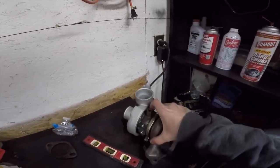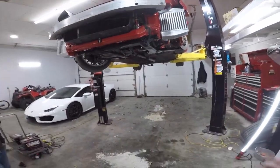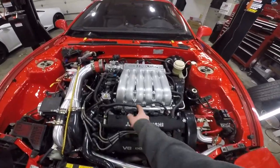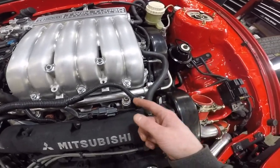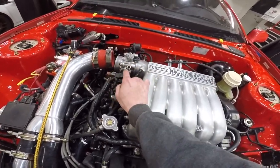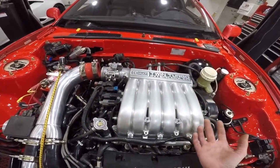The front turbo didn't have any oil in it — only the rear one had a little bit. I still have to put the 800cc injectors in and fix the shift linkage before it goes to the dyno. To do injectors you have to get your intake manifold off. I've got studs so it's all nuts. You gotta decide: do you want to leave your throttle body on and disconnect coolant lines and make a coolant mess, or disconnect your throttle body and slide it out of the way? I'm going to do the latter.